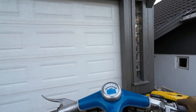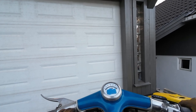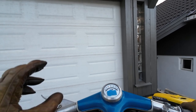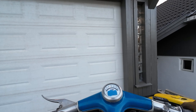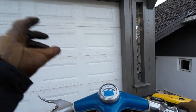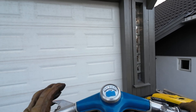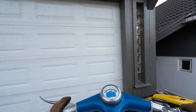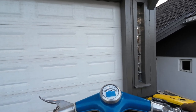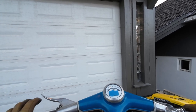Quick addendum: if you are running a Series 2 with my adjustable rear shock, and you fancy buying this exhaust, you really should have something you can adjust — because on this I'm running the settings a little bit firmer than I'd like, because of that downpipe clearance issue. Also, if you're riding a Series 3, that runs with a 300 shock — I would really consider whether you've got enough room to jack up your rear end a little bit just to get that downpipe out of the road. Ta-ra!